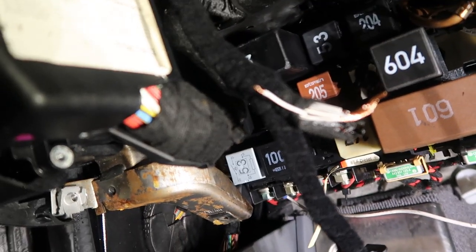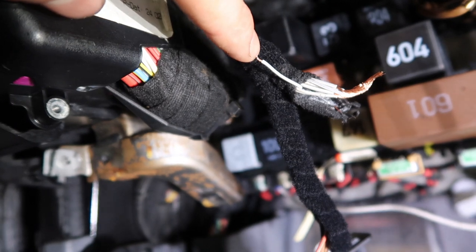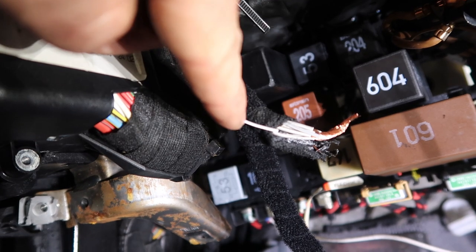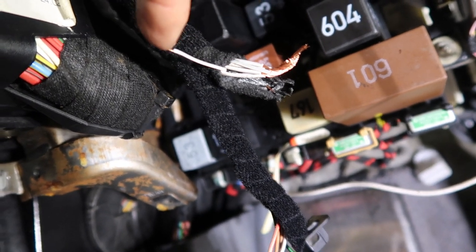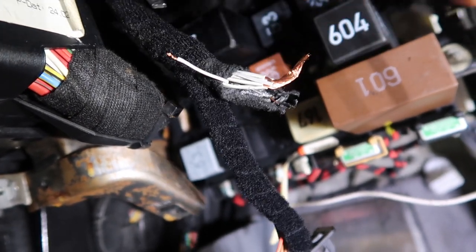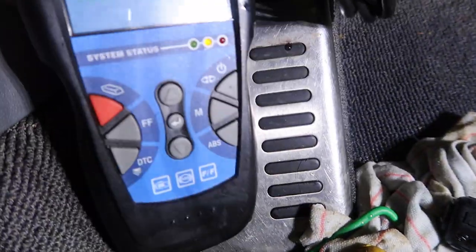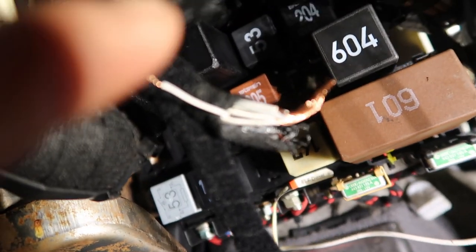Now I'm going to check to see what this wire is connected to. I don't know if it's the radio or not, but we'll find out by checking the ohm resistance. I've got at least these other modules that I can check with my scan tools minus this one, which is huge — I can actually connect to stuff and see what's going on. And if I use my better scanner, I could probably figure out which module I can't read. This one just tells me what my check engine lights are saying, so we'll try the other scanner and see what the problem is.